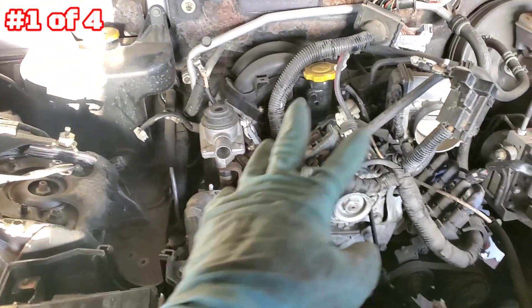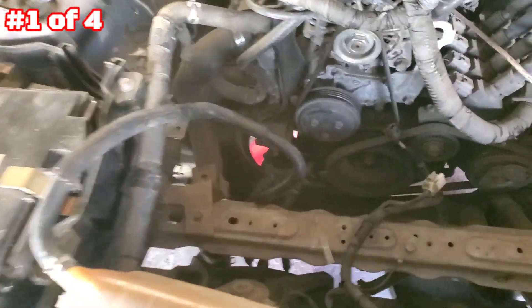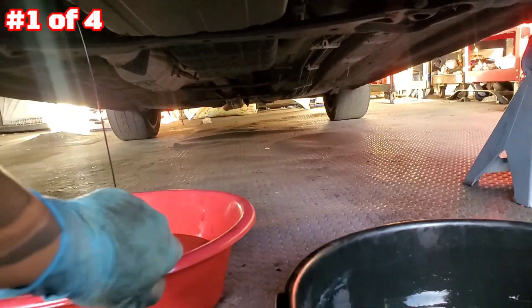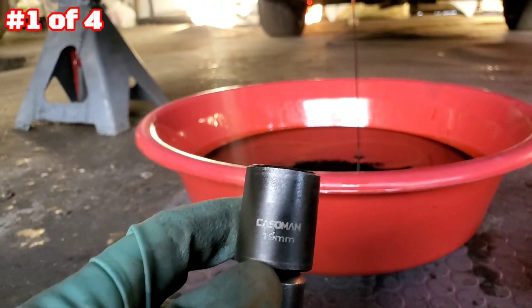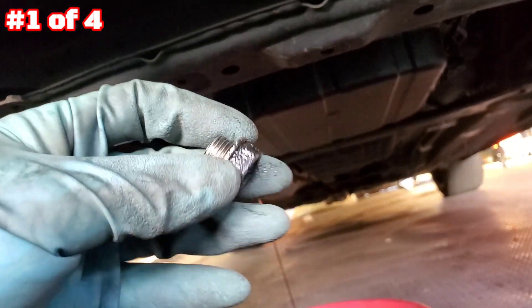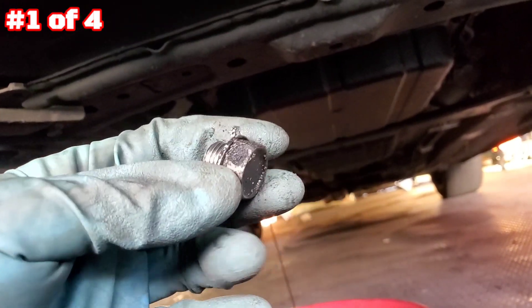The secondary air pump is removed and stays as is — harness, everything is removed, including ground wires. Let's put that to the side. Now with the car on jack stands, to avoid a big mess, drain the oil. As everybody knows, it's a 19 millimeter plug. This is a 2004 or 2005 with the automatic — the engine oil drain plug on the oil pan is 19 millimeter. Removed — drain the oil.